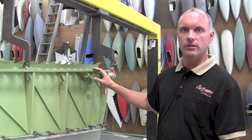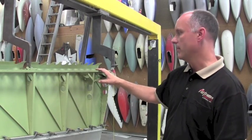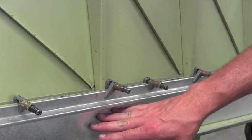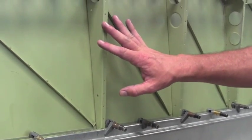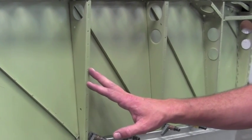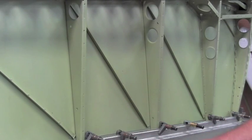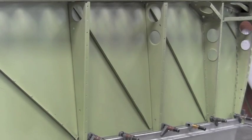These rivets are subjected to a shear load and have a tendency to work and loosen over time, so this is a good opportunity to address those rivets as well. Once the new trailing edge segment is installed, the upper skin is reinstalled on the elevator using all solid rivets, using the original factory size and spacing of rivets, so that once the elevator is painted and reinstalled on the aircraft, you cannot tell it has been removed.